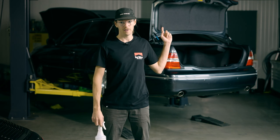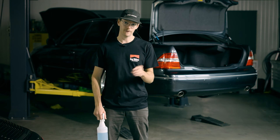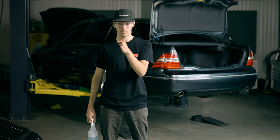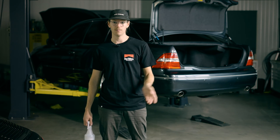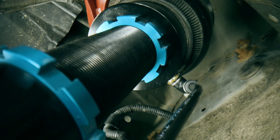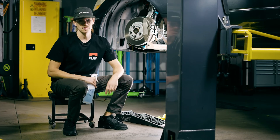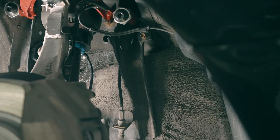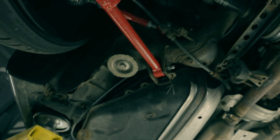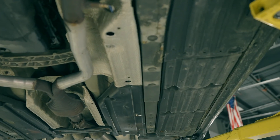In the case of the LS430, we know we have that leak at the driver's front corner, which on a manifold like the Airlift manifold is marked as number one for those four corner ports. So that helps us eliminate a lot of variables — we know to dive right in on that port at the manifold, and check that corner of the car if the port at the manifold is not the culprit. Most leaks are caused by installation errors. We have no leader line for this installation, so let's check here at the PTC fitting. If it's not there, we know this airline has to run from the front of the car all the way to the back.